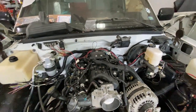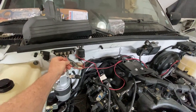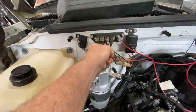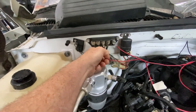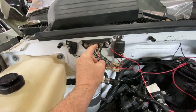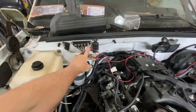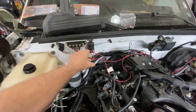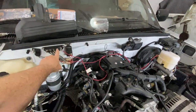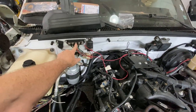Third wire was fuel pump. Again, I didn't have enough gray wire, so I had extra red and used that. It went to this stub out in the center, and the reason why is this is what has typically been the stub out on this year model for the fuel pump relay. So the short version: red wire I connected here for power, pink was coming directly out of the firewall from the fuse box to the second stub out, and third was the fuel pump, which went to this third stub right here.